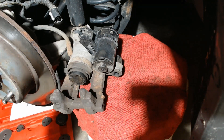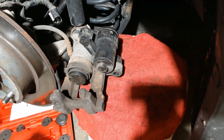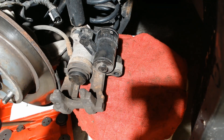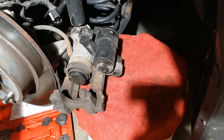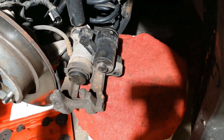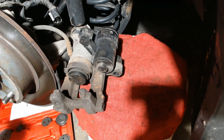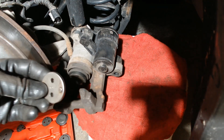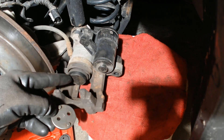I've got the caliper pulled off the vehicle and disconnected the electrical cable — not necessary, just for more room — and removed the caliper bracket. You can see the piston is extended quite a bit due to pad wear; as the pads wear, the piston has to come out further to compensate. I'll show you how to wind back the piston just like we did on previous generation Accords using a turn-back tool. These are available on eBay and Amazon for about $25–30 and come with different adapters. You find one where the pegs line up with the slots in your piston.